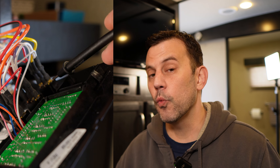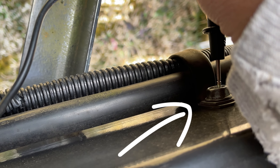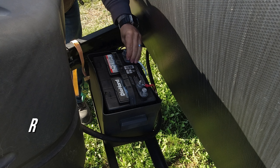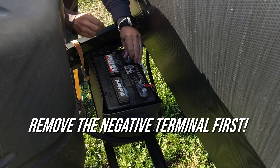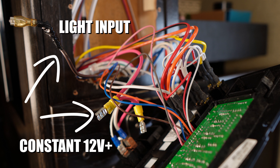Now if you're not seeing a 12-volt reading on your meter, two things could be happening. The white wire you're testing with the negative probe may just not be a good ground — in that case you're going to have to continue testing for other grounds, or put your negative probe on a chassis ground. The second thing that could be happening is the white wire is a good ground but the first wire you chose from your switch is not the incoming constant 12-volt power wire. So just switch your probe over to the other wire and continue testing. Once you know the pink wire is your constant power and the brown wire is the light input, you can begin installing the switch.